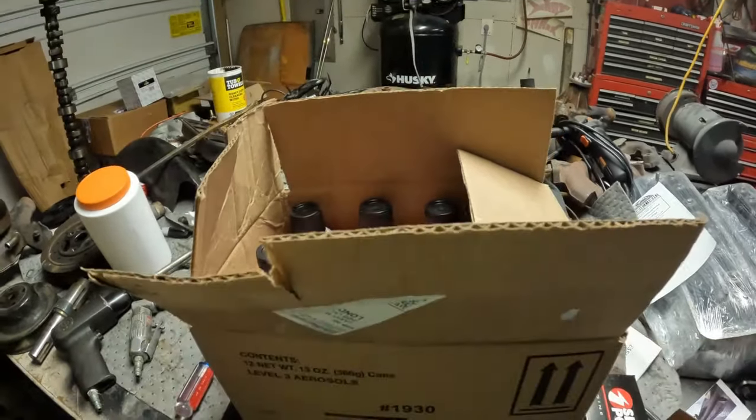It's the next day and I've taken a fresh look at it. I've got this all cleaned up, got all the rust the best I could out. I used a little polishing wheel on this air tool. Now I've got to get inside this backing plate and do the same thing - run it around and get that rust out. I'm also going to get down in here where the sensor goes and use something different to clean that out.